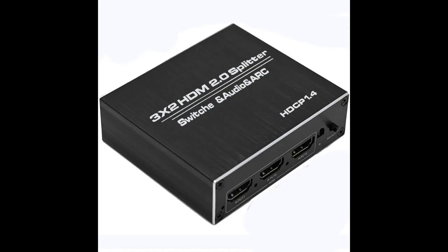Here's a list of equipment that will be needed. You will need an HDMI 2.0 splitter with audio extractor. An HDMI splitter takes a signal from one source like a gaming console and sends it to multiple destinations like your TV or monitors. In addition to splitting the video, it will also extract the audio. I use a 3x2 splitter as I have three consoles attached, but you can use a 1x2 or even a 1x1 passthrough if all you want to extract is the sound to pass to your PC.